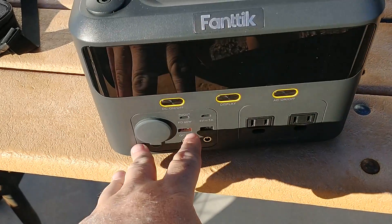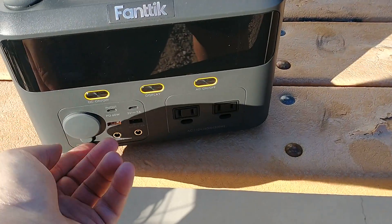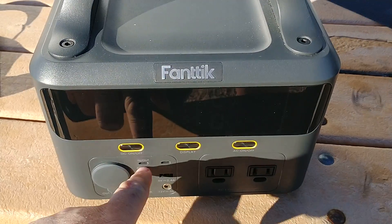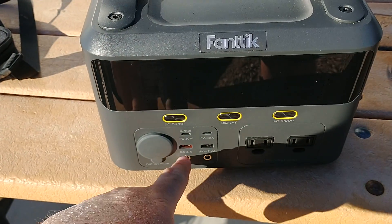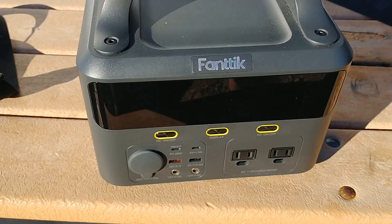Let's go over some of the features quickly. Here's the DC side, there's the AC side. To turn the DC on, press this button; to turn the AC inverter on, press that button. You have one 12 volt - that's your cigarette lighter style plug. This is nice: it has USB-C in and out, so if you don't have your charger you can plug it into a phone charger. You get standard 5V 3A quick charge 3.0, a 5V 2.4A port, and barrel connectors. DC-to-DC is actually the fastest and most efficient way to charge - every time you convert something through an adapter you lose energy.